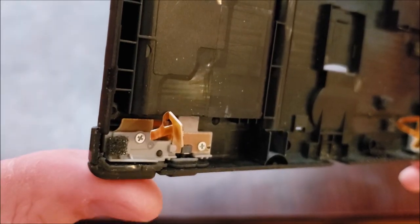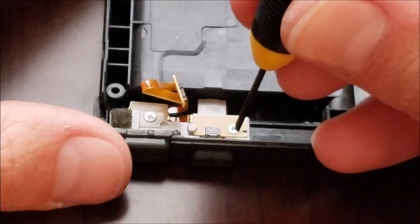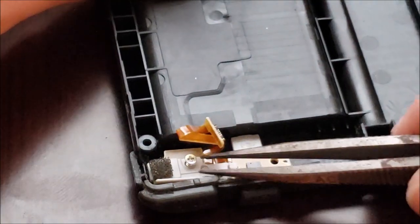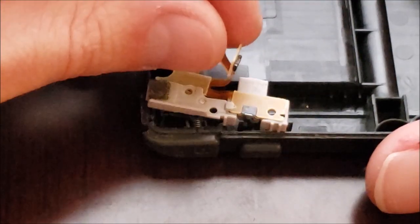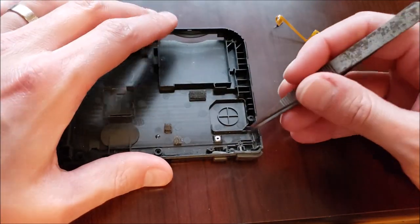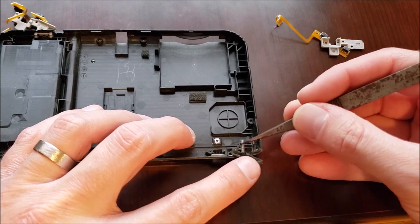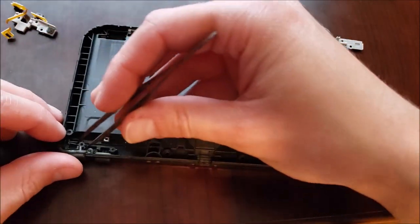We can take a closer look — this one is operating just fine, but over here there's actually a button not being pressed. These screws are small, so be careful with stripping. Take the tweezers, move that to the side, and just pull that whole assembly out. With both the left and right shift assemblies off, we'll remove the triggers. You can see there's a spring in there — just get under there and pop that with the tweezers. Comes out pretty easy; the trigger just flops out.